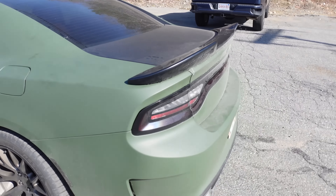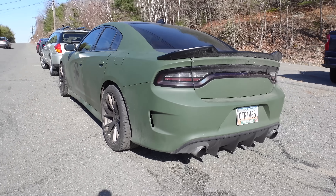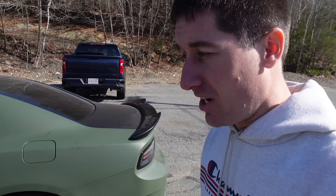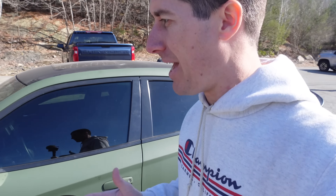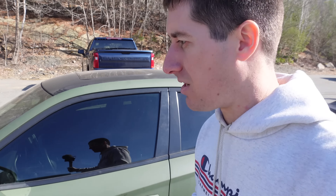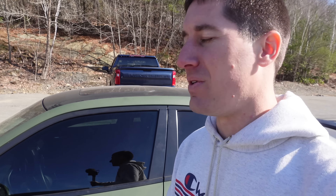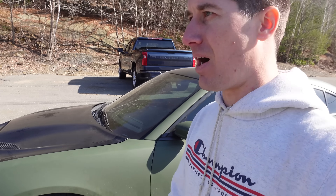This thing looks super angry, sounds amazing. Today we're going to tune it. He installed the DiabloSport but it's still running on a bit of a base tune, so we have the tuner's contact info. We're going to call him and figure out what needs to change — basically sort this thing out so he can actually drive it. You don't want to run around on a base tune with mods. You might lean out, run too fat, blow through fuel for no reason. There's a lot of issues that could happen when you're running a modded car with no tune.